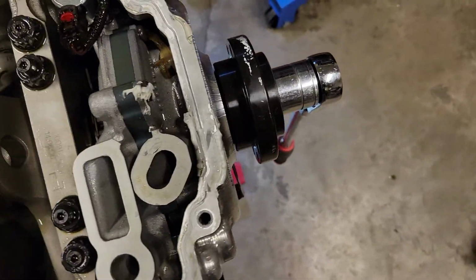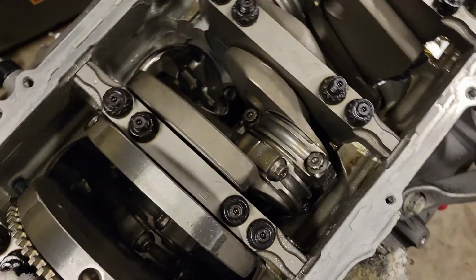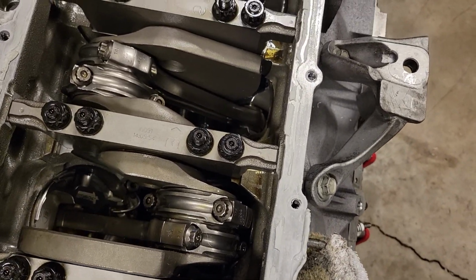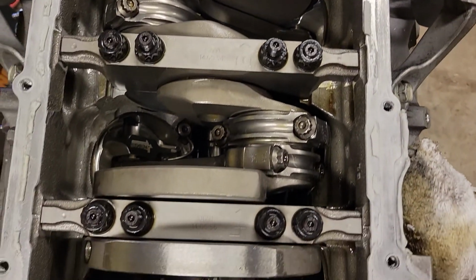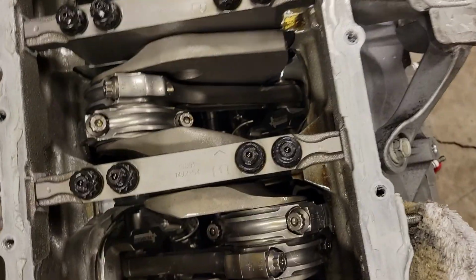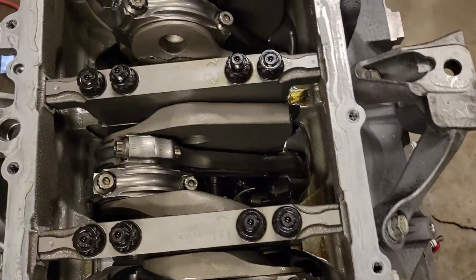I did have to shave the snout down, which is what you have to do for these aftermarket cranks. I don't know what they do. They probably machine it and make their own stroker cranks, but I am just not too fond of what happened here. Look at the condition of the motor. Everything else is absolutely beautiful. No heat marks, nothing else. I went over the entire engine, the pistons, the skirts, everything, no scoring in the cylinders. Everything is great. The crank was just the weak point.